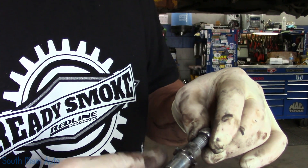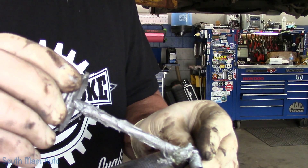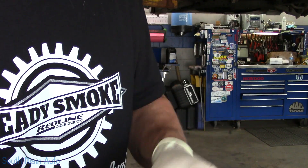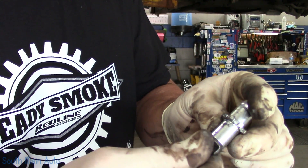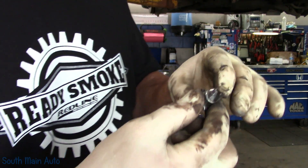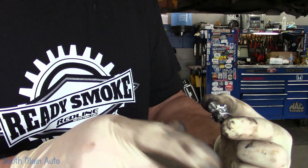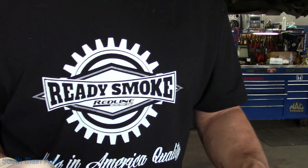Before we put the bottom spring in, we'll put the star adjuster in here. This one's nice and freed up — it's relatively new. Put just a dab of never-seize on it. Thread that back in, and the same thing on the other side — also make sure there's a little never-seize on that, you don't want it to seize. Now I install these in a way where when I stick my screwdriver through the rotor and flick it up, it actually adjusts it out. So in this case, the threaded portion is going to face towards the back of the car on the driver's side. That is not true for all star wheel adjusters, so do not take that as universal advice — that is how I'm doing it on this car.